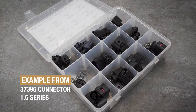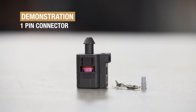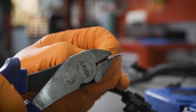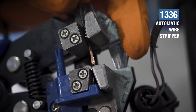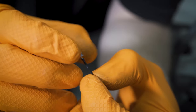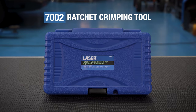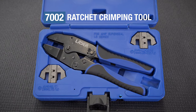Now we can look at replacing a connector that also has a damaged pin. Choose the identical connector from the set — it is a single pin connector this time. Cut off the damaged pin, then strip the insulation from the wire. Fit the new silicone seal over the insulation, leaving the bare wire exposed.